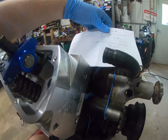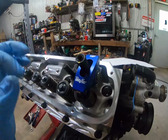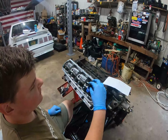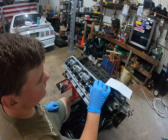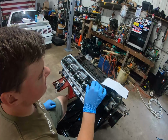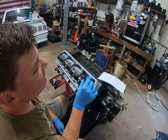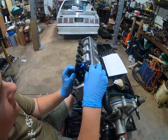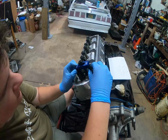So where we're at is just the turning part of the rocker nut. We established our loose 90 degrees. I have a mark here so I can see better how many times I have to turn this, and now we're gonna do that. So I have to do 5.84. 1, 2, 3, 4, 5. Be like 5 3/4 there, right? Yep. I have no idea what a 0.84 looks like. So right now I'm trying to adjust this. Oh, I have that turned in, that 5.8-ish turns. I'm trying to adjust your checker until there's 0 lash.